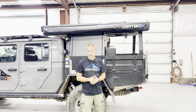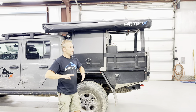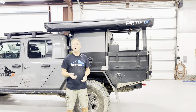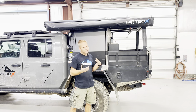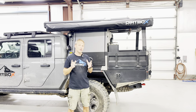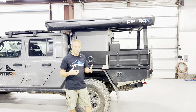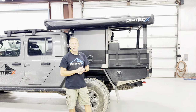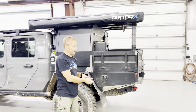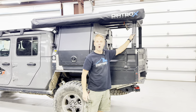Now I've got room for passengers and everything else. The construction of these is extruded aluminum throughout the whole deal. We harden it to T6, so it's going to be more durable than your typical 5000 or 2000 series aluminum. We're able to get tight bends and breaks out of a T6 extrusion because we're not actually bending it — it gets shot out exactly the profile and shape we want instead of bending a flat sheet. That eliminates stress risers, and it gives us multiple mounting points through these tracks, which are all over the flatbed, underneath, and built into the canopy box.